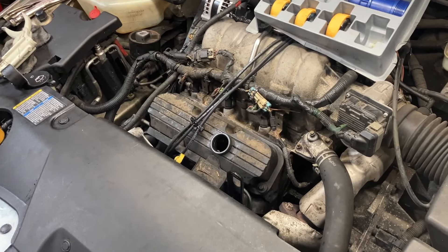What I'm going to try to do is just give that bolt a little snug and see if it stops. I sprayed this all down with brake cleaner and cleaned it up really well, and took this motor mount off just so I could see clearly. I tightened up the timing bolt and she does not appear to be leaking anymore — it was pretty tight but I gave her an extra snug. The leak that was right here was from this bleeder; it was a little not quite snug. I snugged that up with my vice grips and it appears like it is holding pressure now.